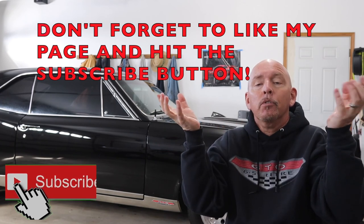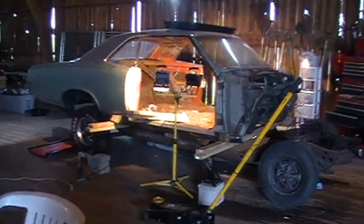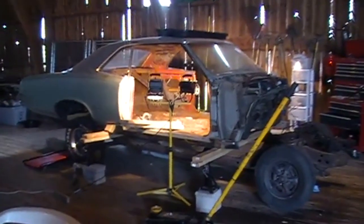Now you have the car completely stripped down and you're ready to either have it worked on by professionals or do it yourself. If you're sending it out, you're going to need a trailer and a truck, and schedule an appointment ahead of time — body shops have told me they're 6 to 8 to 12 months out in advance. Now you need to get the body off the frame so you can work on the frame while the body shop works on the body. In my case, I took the body off, gave it to the body shop, and worked on the frame myself. How do you get the body off the frame? I did it all by myself and I'll show you in the next video how that happened — it's really cool. So until then, take care, God bless, and I'll see you soon.